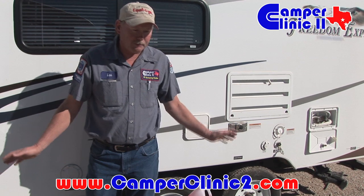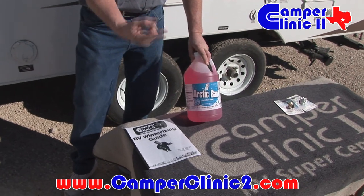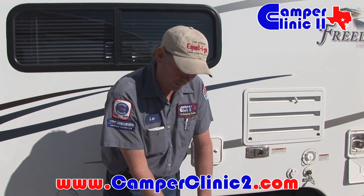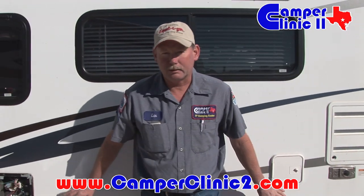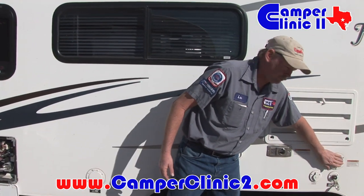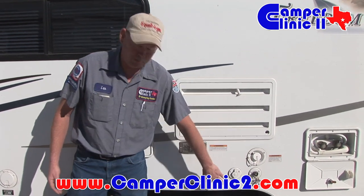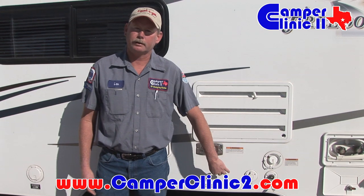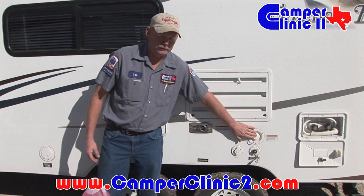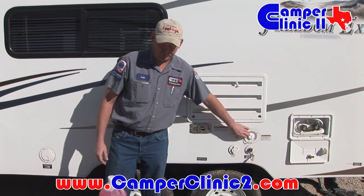That pretty well sums up the short and sweet of getting the water out of the unit. You need to go in and put some antifreeze in the fresh water tank, the holding tanks, and all the sink P-traps, whether it's the lavatory or the sink. Now that concludes the plumbing of the RV. Keep in mind that the fresh water tank — right here is where you fill it on this unit — if it has any water in it, it needs to be drained out. Underneath the coach there will be a manual valve or a cap where you can release and drain the water. I would do that prior to putting antifreeze in, or you'll waste the antifreeze.